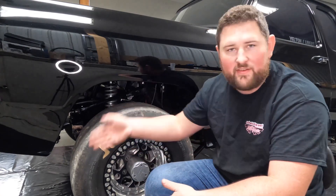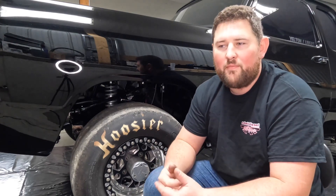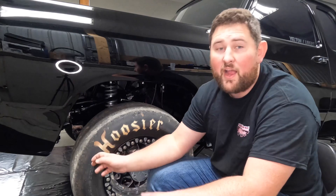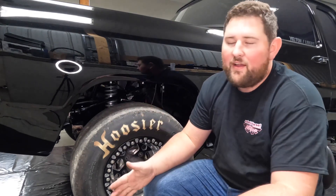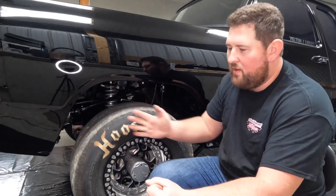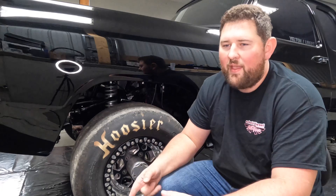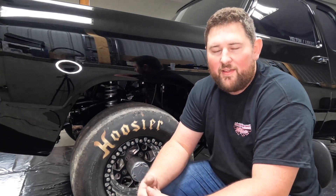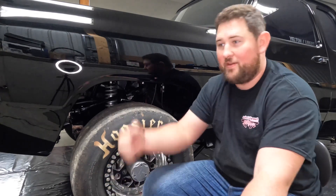So why is this important for four-wheel drive racing? The more scrub radius you have, the further the center of that tire is from the focal point where it's trying to pivot, and the more steering input you're going to get. As you're going down track, any irregularity in the track surface is going to give you more feedback through the steering wheel because of that offset. The other thing is it's harder on the components — the more offset you have, the more that contact patch is further away from the center focus point, putting more load on the bottom ball joint or kingpin, and it's going to be harder on tie rod ends and similar parts. If you've ever four-wheel drive launched a truck with big 12-wide wheels with a bunch of offset, you know exactly why — because it has so much scrub radius.